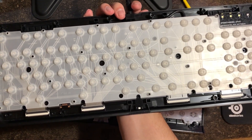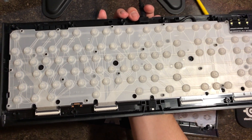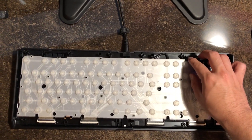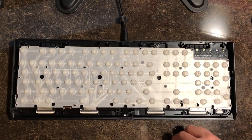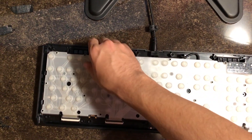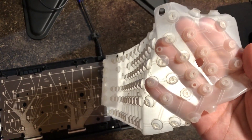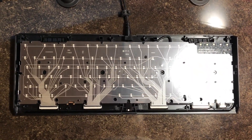When you remove this, the first thing you will see is this little mesh here on the back. This is the part we're pretty much going to be cleaning. You can clean the plastic piece if you want, but mainly we're going to be focusing on the contacts. For my specific issue, it was enough to just adjust this rubbery mesh. I think it came out of the holes it was set in and messed up where it was pressing. We're going to go a little extra and very gently pry this off. You can clean that part if you want — easy to wash with soap and water. Just make sure you dry it before you put it back on, because electronics and water do not mix.